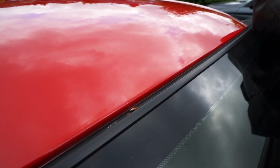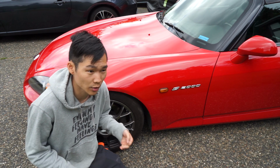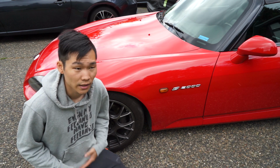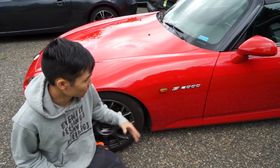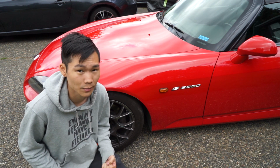If you could get it within a day or two, you'll usually be able to rub most of them out with just a little bit of light polishing compound and some light pressure with a microfiber towel. It's a lot easier to do it with consistent lighting, so you could constantly check over your spots, but unfortunately I didn't have that available with me.